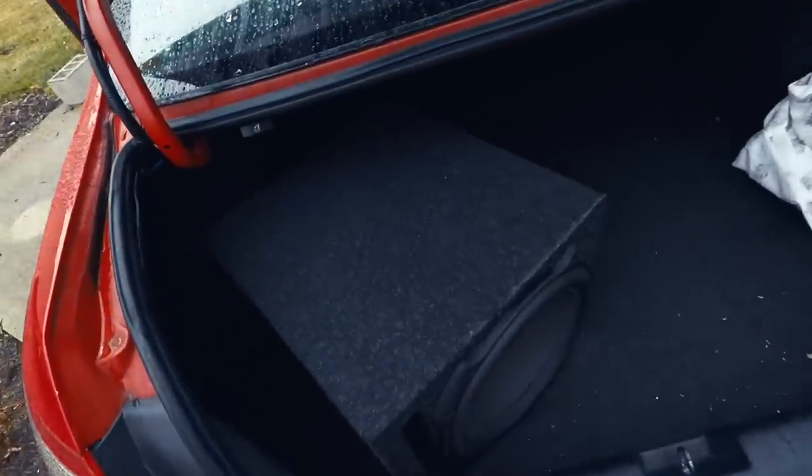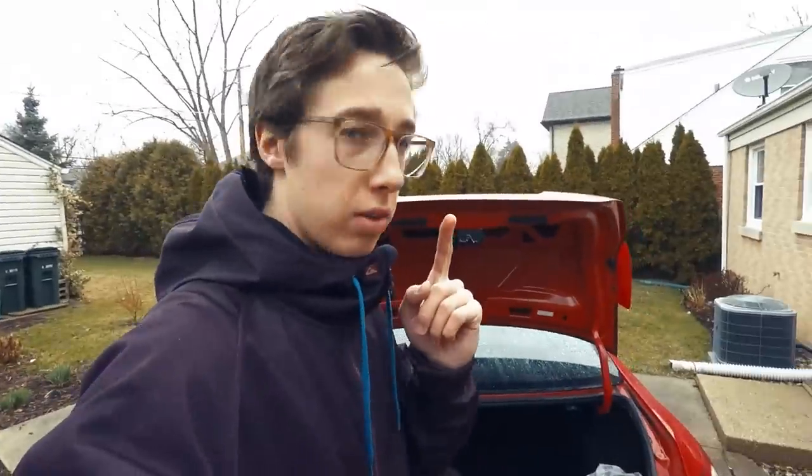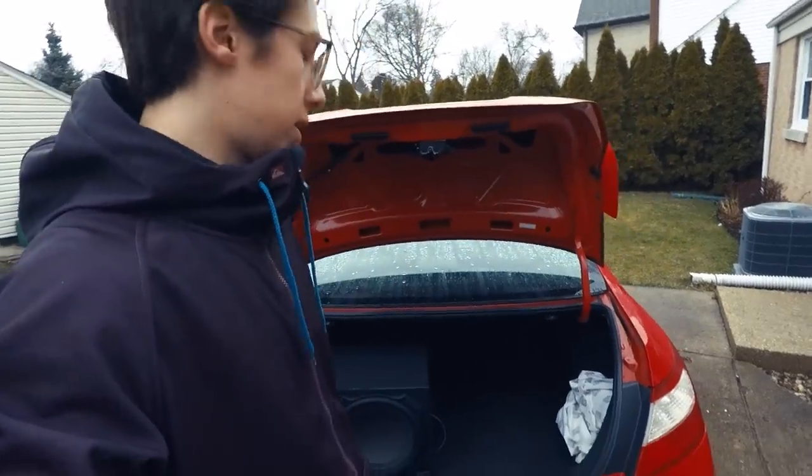I don't really know where I fall yet — I'm giving it about a week to decide. One big con to this box setup is that it is a lot bigger; it takes up a ton more trunk space. Look at this — it goes all the way back to my hand. This box for a single 12 is huge. The other advantage of a ported box is that it's a lot more efficient than a sealed box. The sealed box uses air pressure to keep the bass really tight and punchy, but this obviously lets air in and out. It's basically just the amplifier moving the sub, so it requires a lot less power to get loud bass. However, it can still be kind of whooshy — I feel like if I had a more powerful amplifier, it wouldn't sound the way it does.